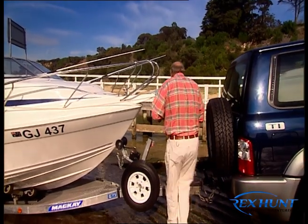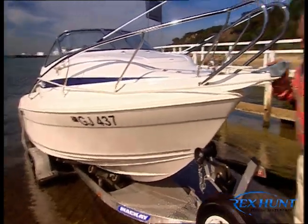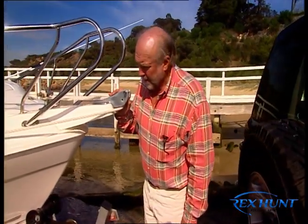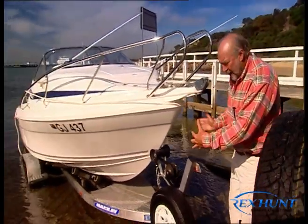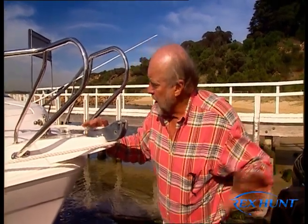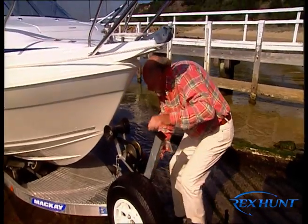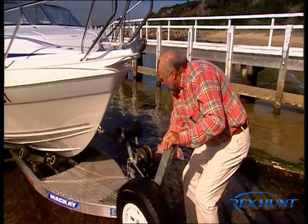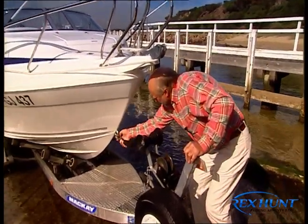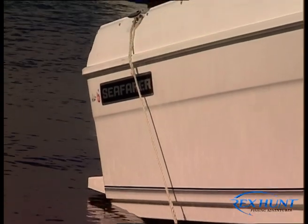The most important thing is to make sure that the trailer has enough water to float the boat. Now some people put the car in and when the bubbles come out the exhaust — yibbity yibbity folks, she's all over. But the boat is designed to float on top of the trailer and it acts as a cradle. Now a lot of people say, where's your launching rope? Well if there were two of you there certainly would be, and my special guest is just getting ready to say hello. So what I do when I'm on my own, I take the pressure off the winch, undo the safety chain, and allow the winch to go down as far as that. The slack comes up and the slack is there because there's a nice little rope down the bottom holding it on.